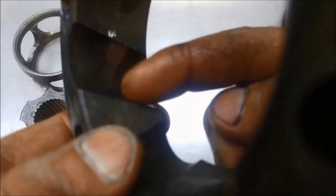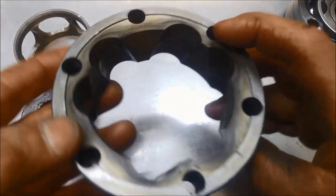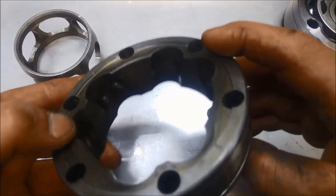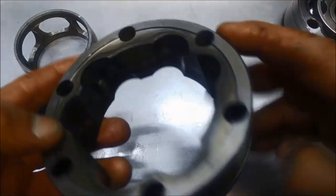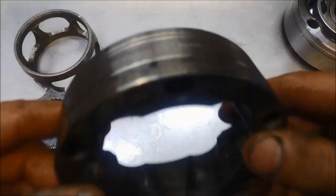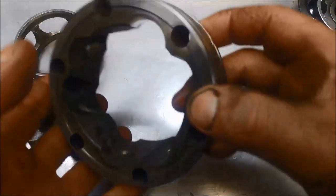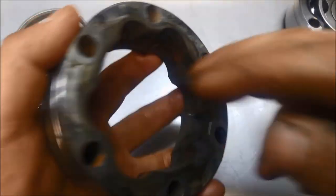These also you can't flip over because that's the side that goes towards the gearbox. Usually has a gasket on the step there. And the flat side goes towards the wheel. So when you're assembling these, you assemble them from the wheel side, in towards that way.